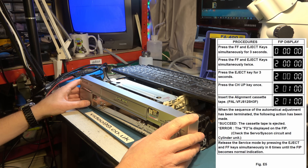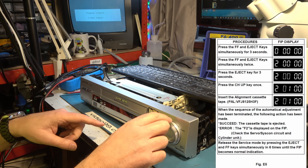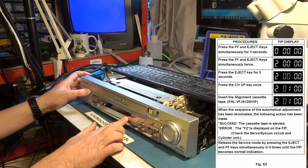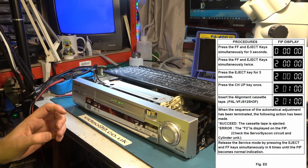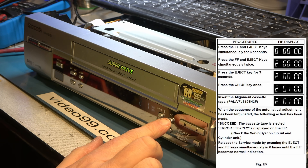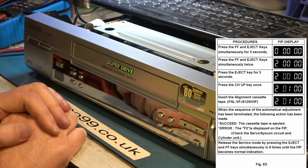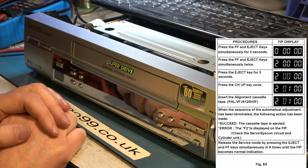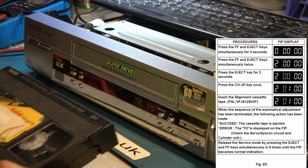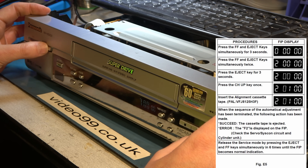We need to press fast forward and eject simultaneously twice to get that down to two. It had already done one because the fast forward button is terrible. Then press eject for three seconds and those segments should go off — yes, it flashed, that's working. Then press channel up which you can also do on the machine itself: once, and you get one on there. Then insert a tape — you're supposed to use an alignment tape but we don't have one, just a tape recorded on a new Super VHS machine some years ago. If it works it ejects the tape; if not it comes up with an F2 or F20 error. That should now be in good working order. You can release the service mode by pressing these buttons until you step around to normal operation.